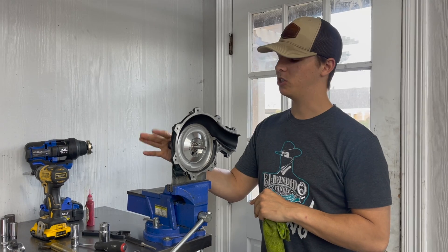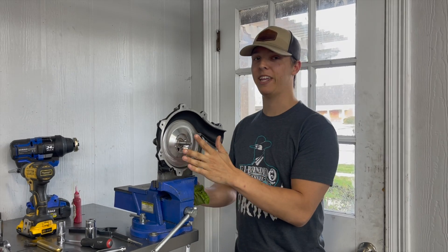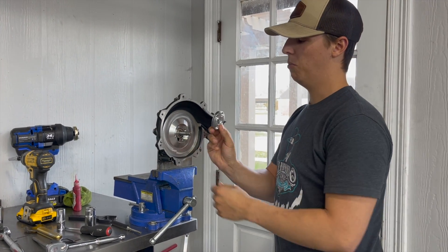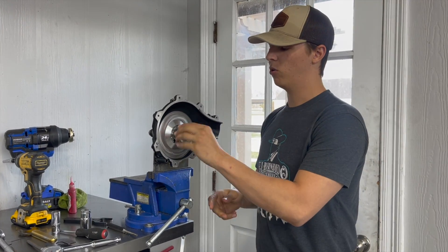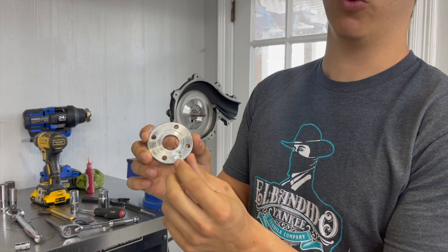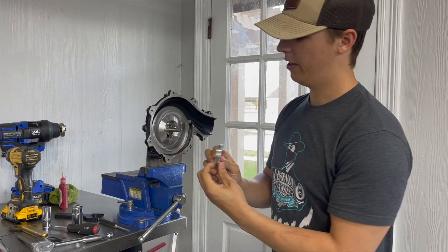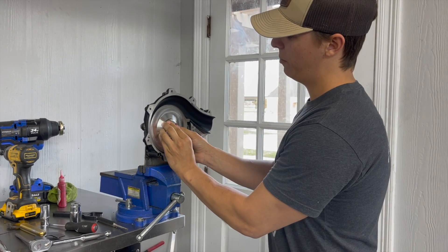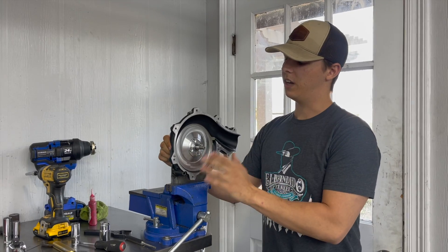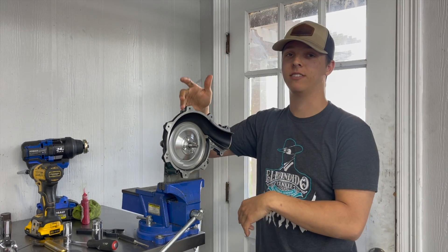Now that I have all the bearings in and the shaft in the supercharger we're almost done assembling this. The 300 superchargers have a completely different oiling system and retaining plate than the older style, and we're going to take a look at that. The new retaining plate just bolts in — you can't just put it in any bolt holes or the oiling system will not function properly. If you look at the back of this retaining plate you have this recess here, and it's important that it lines up with the drain back for the oiling on the supercharger. With that lined up we'll pop it in, get the bolt holes lined up, and thread in all the screws and torque them down. With all of this done we're good to go with putting the supercharger impeller on, putting the front housing back on, then we'll flip this around, set the slip, and the supercharger is done.